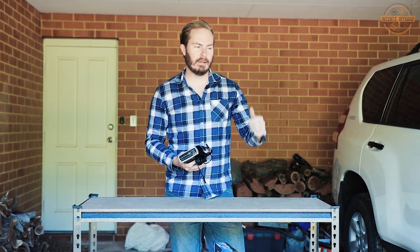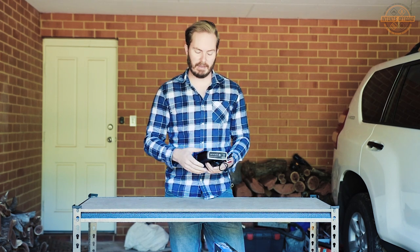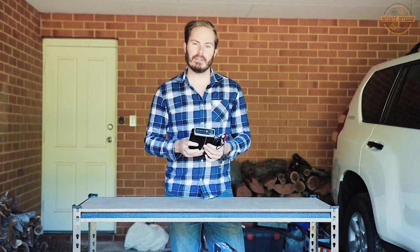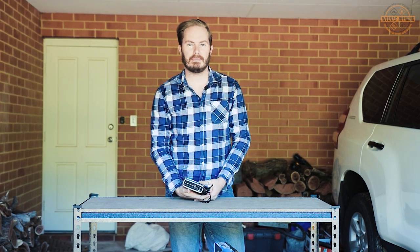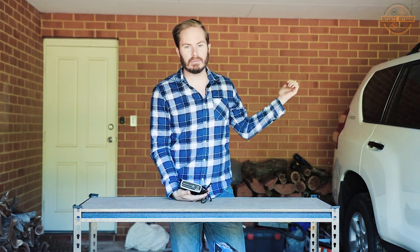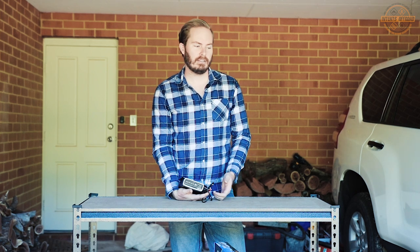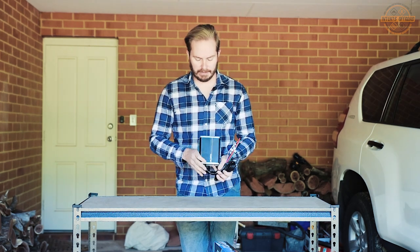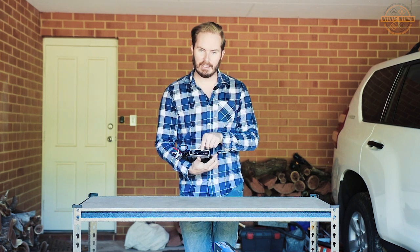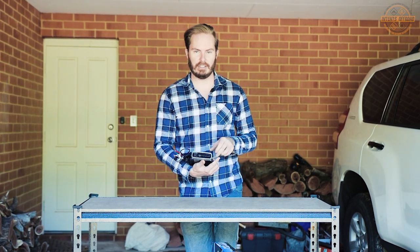If you're doing a battery installation up the back of your car — like I've got third and fourth batteries in my patrol, or you've got a dual cab ute with batteries in the back — you also need one of these. Because if you use one of those isolators you get voltage drop. You might have a healthy 14.4 volts at your main battery, but by the time it gets through the cable run to the back of your car it's dropped to like 12.9 volts. That's a healthy voltage to run your accessories, not a healthy voltage to charge your battery — your battery is going to suffer long-term. These things compensate for all of that. On top of that, it deals with different battery chemistries: gel, AGM, wet, or calcium. This one doesn't do lithium — you've got to buy a very expensive charger for lithium batteries.